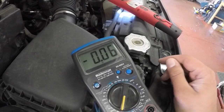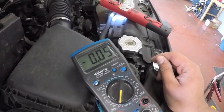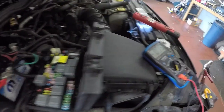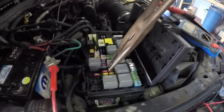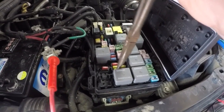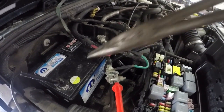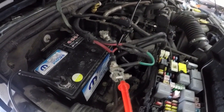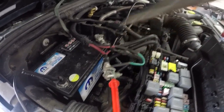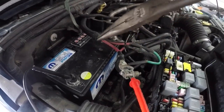I disconnected the radio and reconnected it, done the whole process again, and we're not really running into any issues with amperage. I think what we'll end up doing is pulling fuses one by one to see if there's any differentiating voltage. Initially, I think the issue was that the battery was kind of pooched — the guy would get boosted, take a short drive, and the battery wouldn't be charged enough to start back up in the morning.